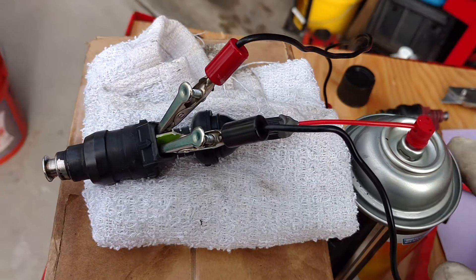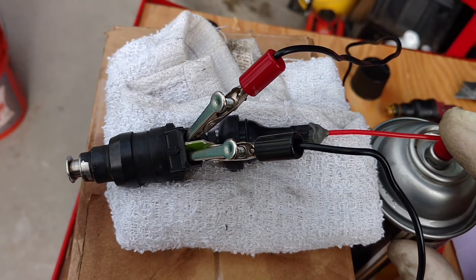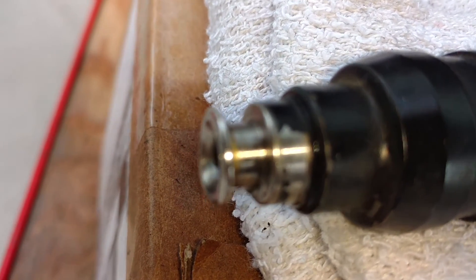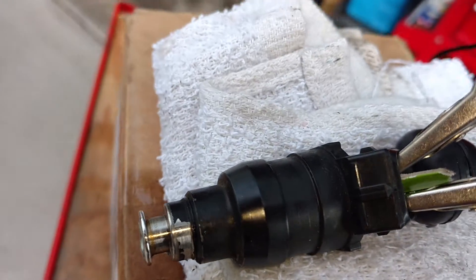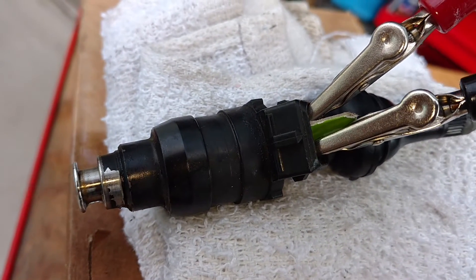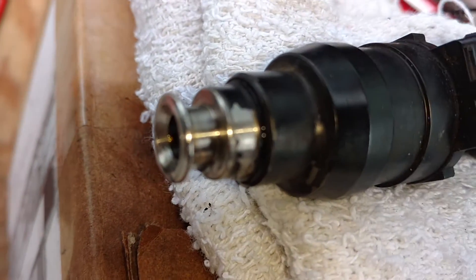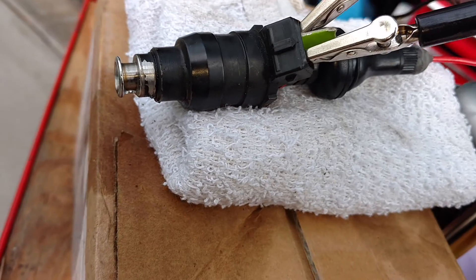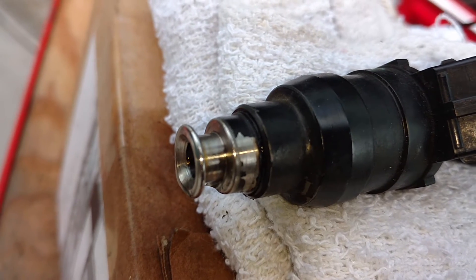You basically use an aerosol can and you do this — you'll hear me pressurizing it, and you can hear it leaking. You can see fuel or carb cleaner coming out, and then with pressure built up you can fire the injector. If I had two hands — but you can still hear it leaking. Pressurize it again — there you go, that's a leaking fuel injector.